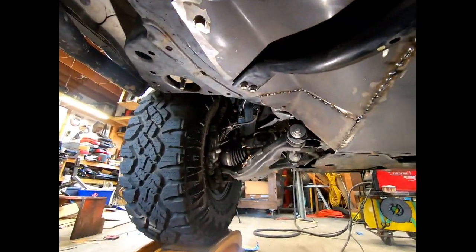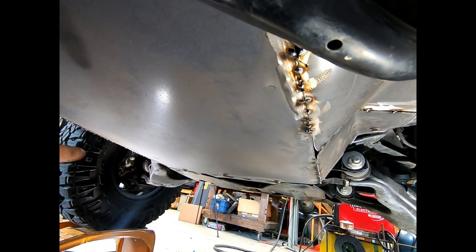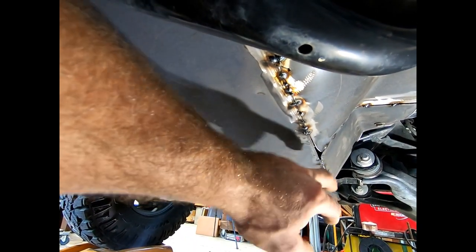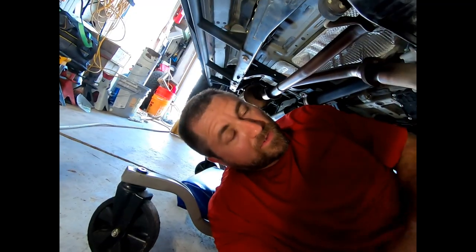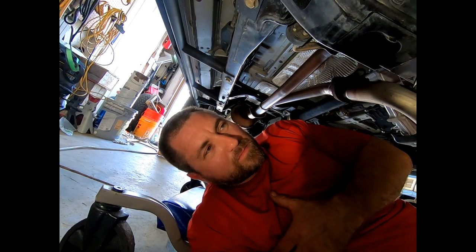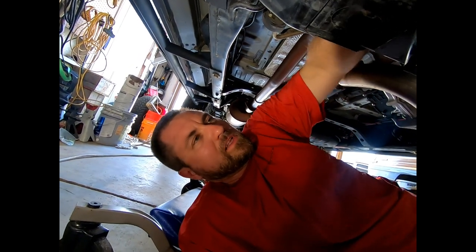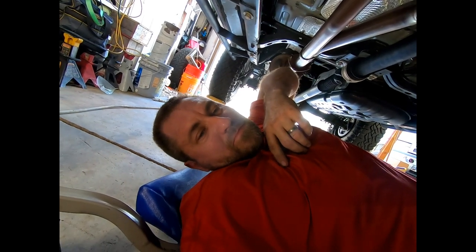I got this side all done. Pretty strong, it's just stitched in there, need to do some more. This side wasn't as pretty as the other one — I have to admit I missed a little gap right there, got a little too aggressive with the cutoff wheel. But that's going to be okay because I'll take some body hammers, knock it out to actually line up, put a filler piece in, just stitch it in, and be fine. The next step would be to undo everything, pull it all the way off, finish welding it, and pretty it up a little bit. We're going to machine this thing down a little bit, do some grinding. In all, I am very happy with it — it's got some pretty decent bends, and it clears with plenty of room between my catalytic converters and this. Let's pull it off, grind it down, and go to the next step: making vents.